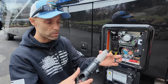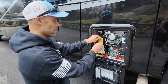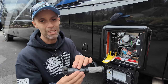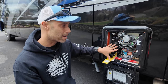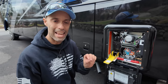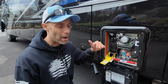Normally how this works: you have your filter — this comes from Truma. We are winterized, so there's nothing in here. This filter will go in here, then this closes up and it will keep the water in there. What we're gonna do with this winterizing kit is replace this filter with another filter that has an electric element in it. It looks exactly the same. When that goes in, it's gonna keep everything nice and hot as we're going down the road. Just keep in mind, you can use the Truma with the antifreeze kit in it, but you can't use the hot water unless the propane is running — you can't just run on electric; you have to use the propane.